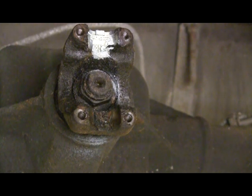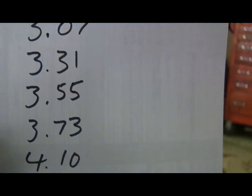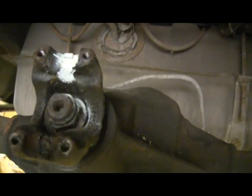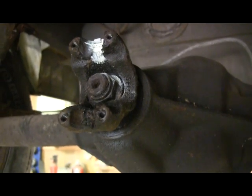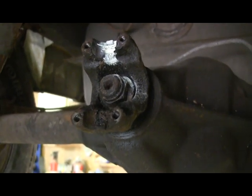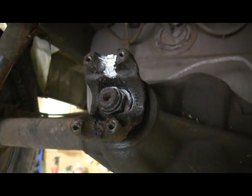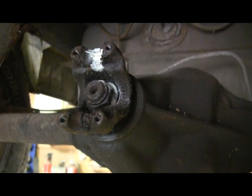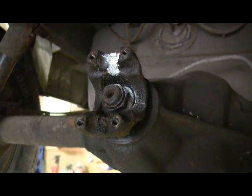So it's going to be the closest ratio to 3.5. Referring back to what we found on the internet, we've got a 3.55 — so that's a 3.55 ratio, because the pinion turned three and a half turns. If it was a 4.56 ratio, it would turn four and a half times and end up in the same spot. That's one way of doing it and it's probably the most common way. Just make sure both wheels turn. If you've got a vehicle with an open diff and you jack up one wheel while the other stays on the ground and isn't spinning, the pinion will turn twice as fast — twice the number of turns. So if this was a 3.55 ratio it would turn about seven times, and you'd divide that number by two. Good luck.